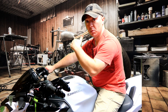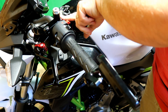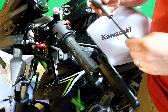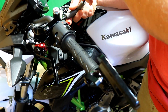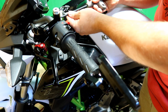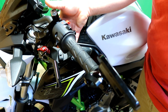Walk around the front of the bike and make sure they're level. To do this, take a 6mm Allen — you have a bolt here and here, top and bottom. If you have the handy little T-handles, you can use those to break them loose. Just loosen your bolt a little bit; it doesn't take a whole lot. Then you can easily rotate the controls to where you want them.